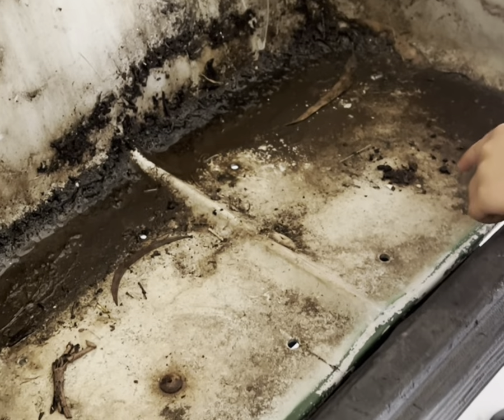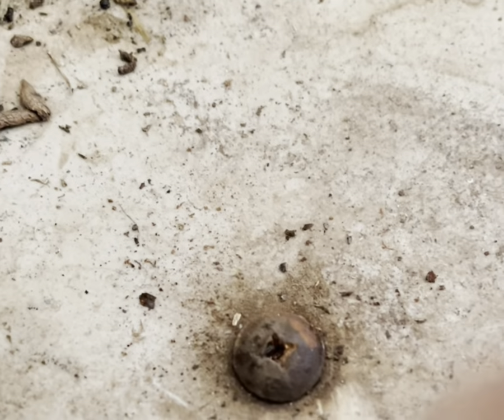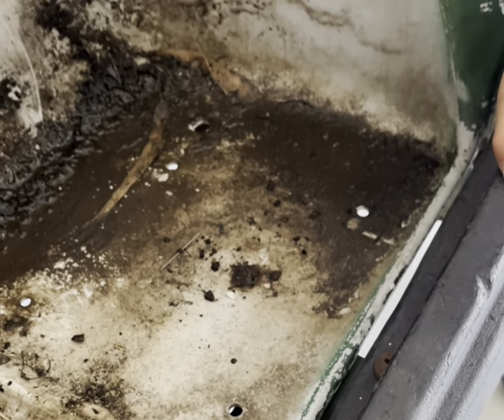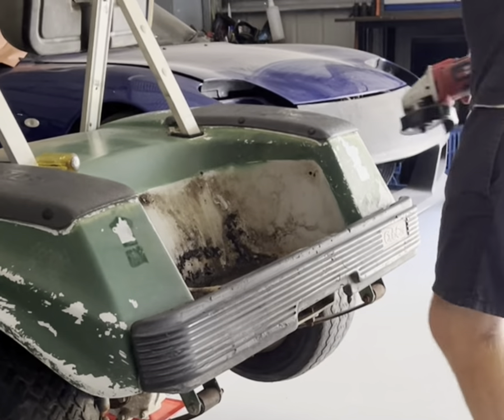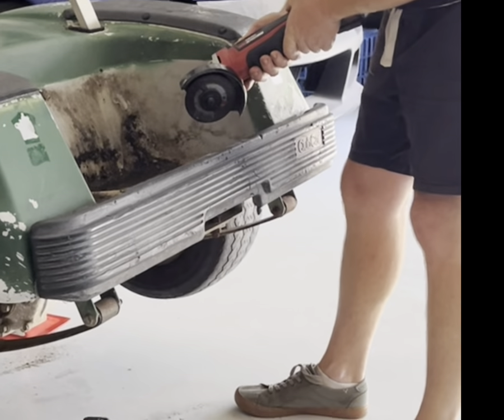There are some bolts hiding underneath this panel. They went through like a hot knife through butter - well, soft melted butter. Those look like they might have been button head cap screws - actually they were star, then Phillips head. We already snapped one because it's rusted in. We're going to have to cut these - I'll get you a grinder.